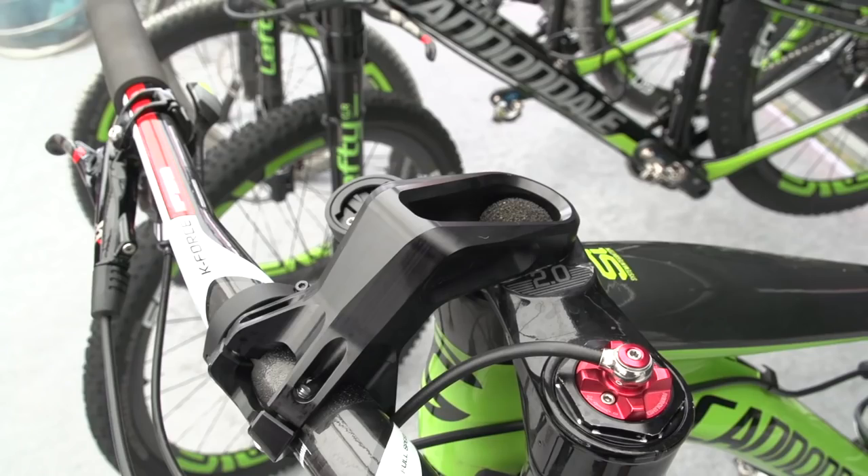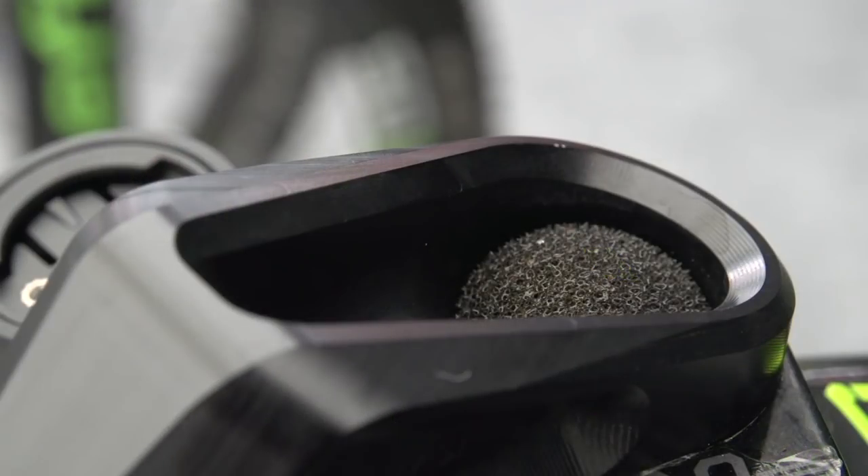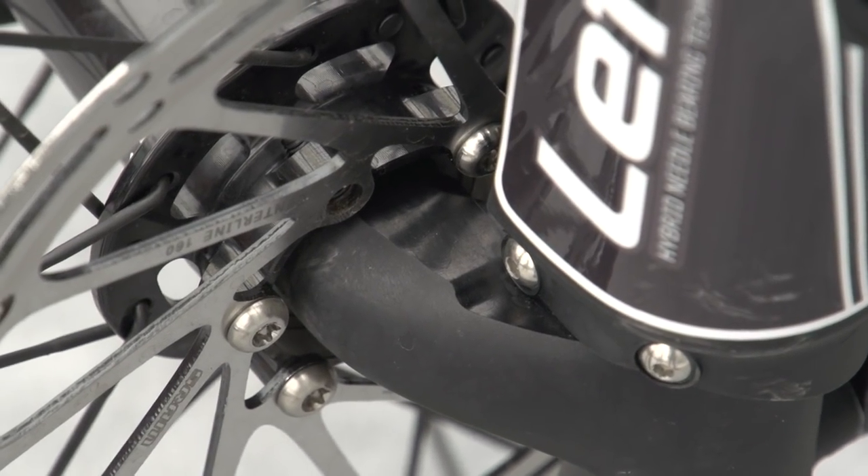We're over at Manuel Fumix's bike. Something I've noticed is foam down the steerer tube. Yes, this is just a little trick to avoid mud, dust, and soil getting in — to prevent dirt and to protect the threads of the steerer tube. Also, I notice it's not six disc bolts — there are only four. There is a reason for that. It's definitely not for the weight savings. What's important is how quickly you can change a disc in case it's bent. It's quicker. These bikes get checked twice a day, so four bolts are enough if you have a mechanic.